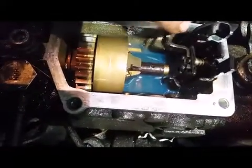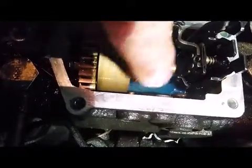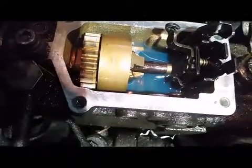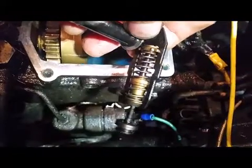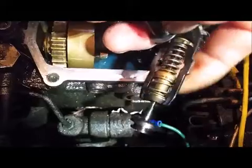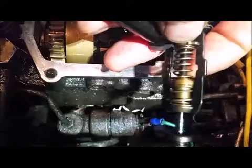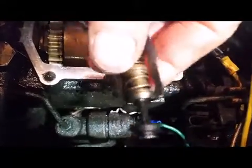This is the throttle control here, with various other adjustments. That bolt is on the outside, and this is the spring that pulls back to the cold start position. This is clearly better and I fully expect this to work. The other interesting thing to note is this is the governor spring assembly, which people modify to get greater fuel — they put spacers in the middle section here.